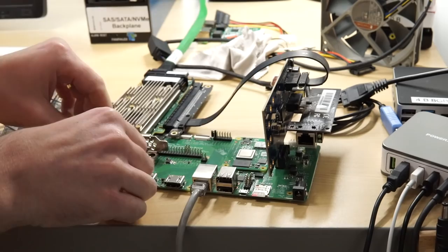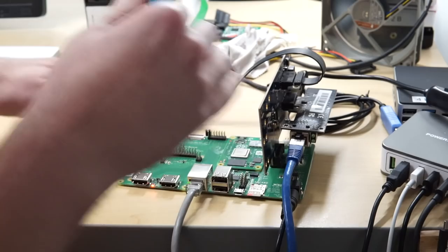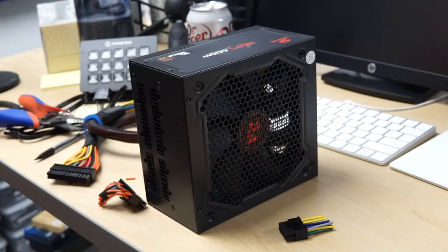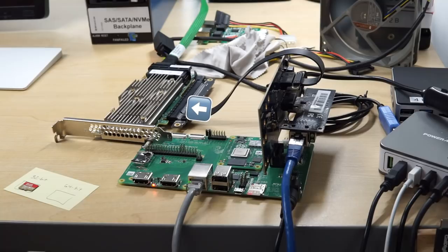At this point I was going to plug in a PCIe switch so I could plug in a 2.5 gigabit LAN card and the storage card at the same time, to see if I could blow past the 117 megabyte per second limit. But both of my PCIe switches couldn't provide enough power for both cards using my 2 amp Molex power supply. So I pulled out my big 600 watt PSU and was hacking a connector together to tell the PSU to turn on — unfortunately I released the PSU's magic smoke. Because of that, I can't power up both the network and storage cards at the same time, so you'll have to wait to see how the Pi gets on as a 2.5 gigabit NAS. Maybe support me on Patreon or GitHub, or click that applause button on YouTube, and I'll be able to replace this power supply for my next video.